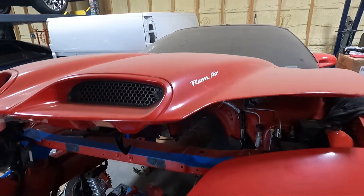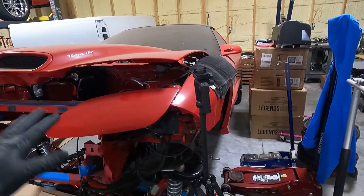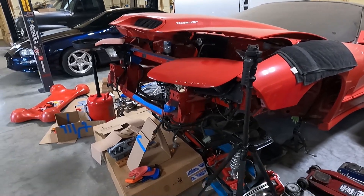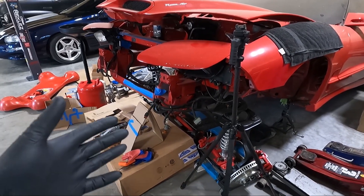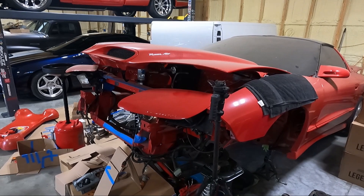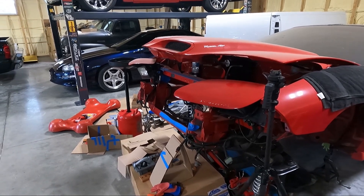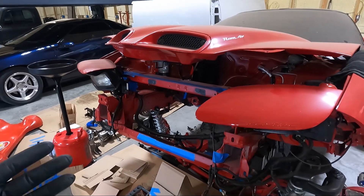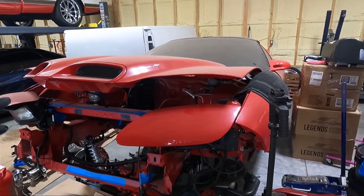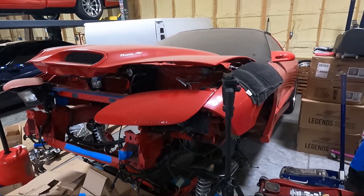While I had that motor out, I put in a Texas Speed set of heads, a 228R cam, and got the motor set back in there with an aftermarket K-member. We were getting ready to tie that up when Heron Speed said they were coming out with an APS-style twin kit that doesn't work with the crossmember I had. So I ordered that whole kit and waited. Nothing against John — he's gotten me parts. There's just been other things that tied me up, other projects. And to be honest, I hate that you only have to cut a few things to make the kit fit — it drove me crazy. So I've been dragging my feet, and then we pulled the motor back out and took the K-member out. That's where we've been for quite a while.